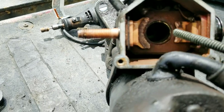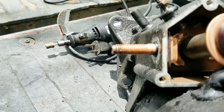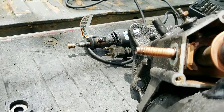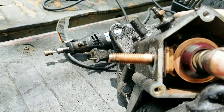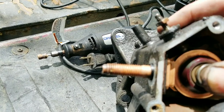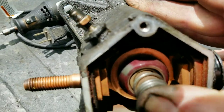The way it works - this piece is not supposed to be like that, it's supposed to be thicker like that. So this sits in here, plunger, and there's just a little spring on there. The plunger sits in here, and when you hit the start button a magnet pulls that down and makes a connection. But you can see it's connecting there but not so much there.